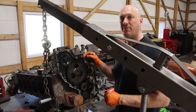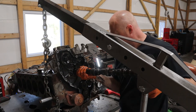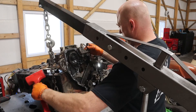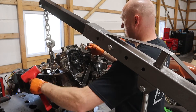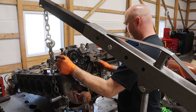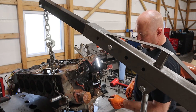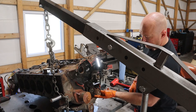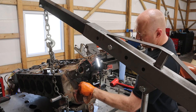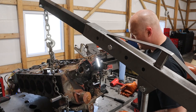I'm going to get this camshaft pulled out, pull the cover plate off, and continue from there. This gasket here is the one that leaks all the time. On the newer ones, it seems to leak from this area down in here; on some of the older ones, it leaks right here and will actually push the gasket out due to crankcase pressure. This one is old enough where it probably wasn't affected by that, and it looks to be in good shape. Overall, the block still looks good — let's pull this crank out and see what we've got.